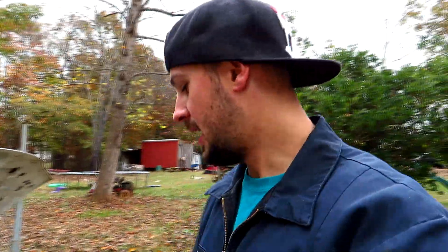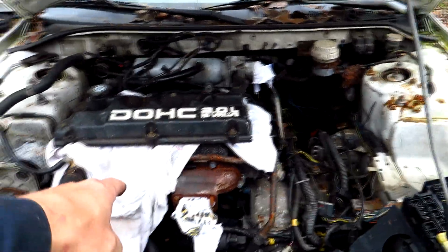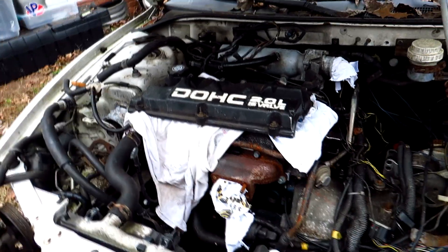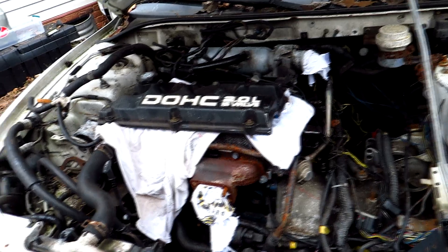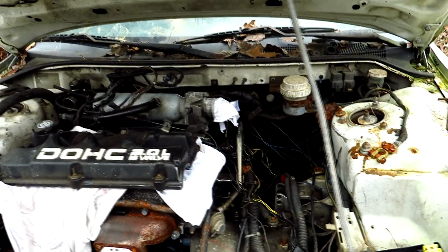There's a lot more to this car than that. It also comes with 750cc fuel injectors from Injector Clinic, which are pretty much brand new. Reality is, they got all this stuff done, put a new transmission in it, and then it acted like it was going to do the same thing again, so he parked it and gave up on it. In the bottom end it also has a Wiseco 8.8:1 piston attached to an Eagle H-beam rod, which I think may have six to seven thousand miles on the block. It's got a tapped oil pan — I'm not sure if it's dented but I still have a brand new one anyway.